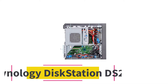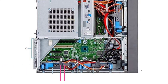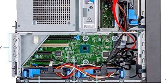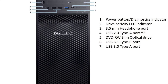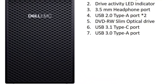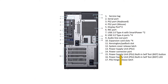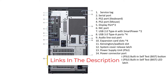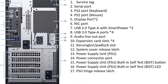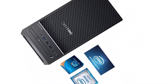Number 4: Dell PowerEdge T40 — Best DIY Plex Server Build. With its Intel Quad-Core Xeon E2224G CPU and 8GB of RAM, the Dell PowerEdge T40 makes an excellent Plex server. It's got an impressive 7,490 Passmark score. Because video transcoding is incredibly CPU-intensive, Plex recommends a 1,500 Passmark for transcoding a single 720p 4Mbps H.264 file and a 2,000 Passmark for a 1080p 10Mbps H.264 transcode. As such, the PowerEdge T40 should be able to handle about 4 simultaneous 1080p transcodes.